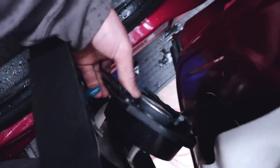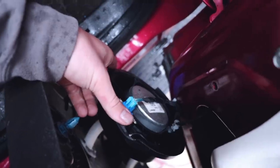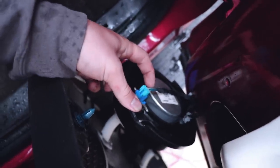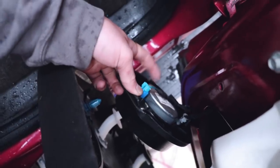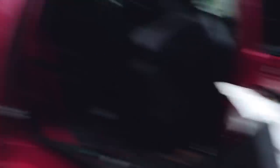As you saw, all I did was take a picture of this. We've got our grayish blue and dark navy blue wire in here — so those are your speaker wire colors. You don't want to tap in behind the door because you've got to fish through here. The same color wires are located behind this plastic panel — just things to look out for.